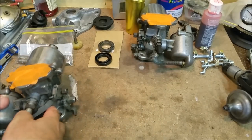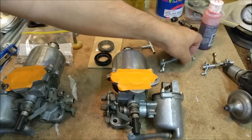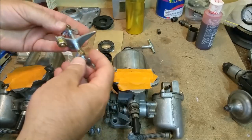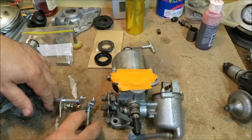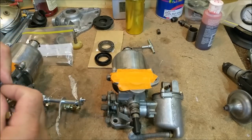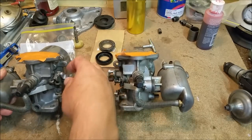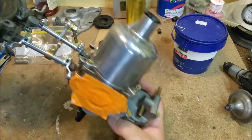We've got our front and rear carburettors and our linkages - that's a T-piece, we don't need that for now. I can't remember which linkage is which - they're the same-sized things. I think it's the throttle cable so that would be there, and this one would be the choke which I have to adjust out. That should all plug together - I might grease these actually. I'll get a spot of grease in with each other, like that. I'm going to put those on now.